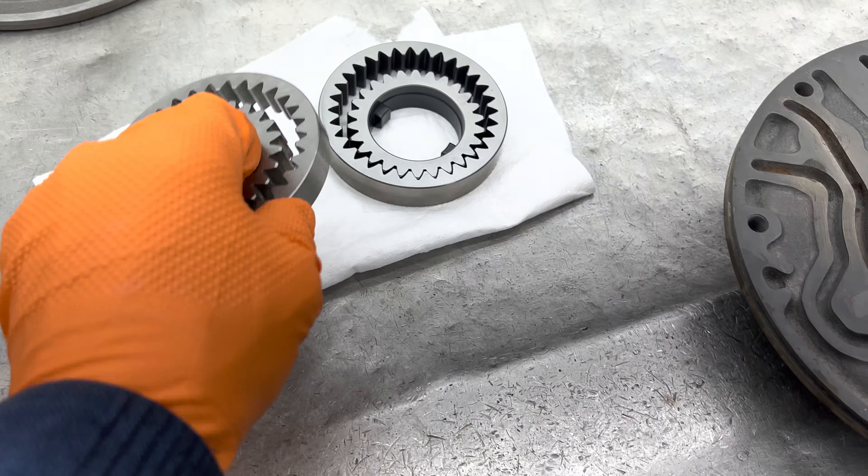So what we've done is drilled a 3/32nd hole in the pressure port here. Then we come over here — you can see it's in the middle of the backing of where the gear is going to be running. And then we chamfer it just a little bit to give it a little pocket. That puts a lot of oil on the back side of that gear that's trying to be pushed against it. And what it does, it just pushes all the oil out, and this basically puts it dry on this back area back there. But that's how we make that live — the pump body and gears will live so much longer when you do that.